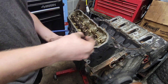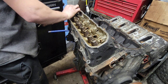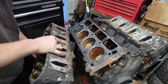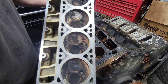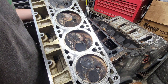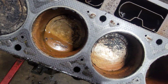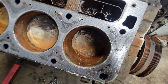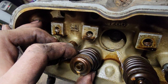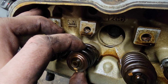These are all short head bolts, so this is a later model 5.3. That's why they were so tough to take out. Let's see how much coolant we can dump on the floor — hopefully none. That came off super easy. Combustion chambers look good, just very dirty. This head is actually super clean; the head gasket barely even stuck to it. Already seeing some signs that this motor's demise is probably from sitting outside in the rain. Just about to pull this head off and I realized — that valve spring is broken. See where it's split right there? Snapped right off. Let's get this off and see if that valve is damaged.